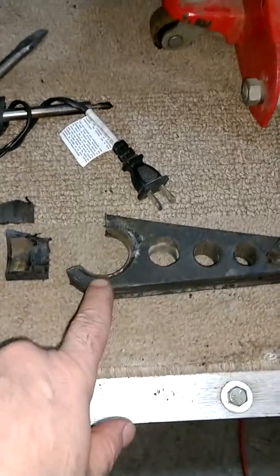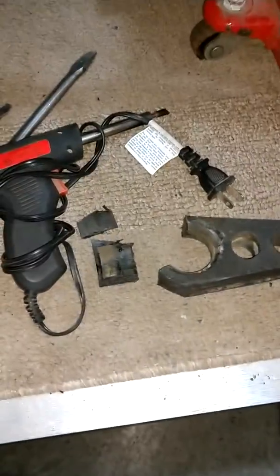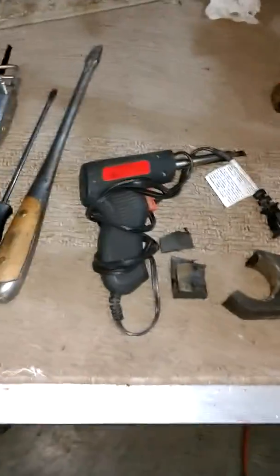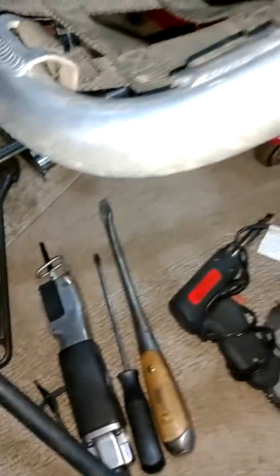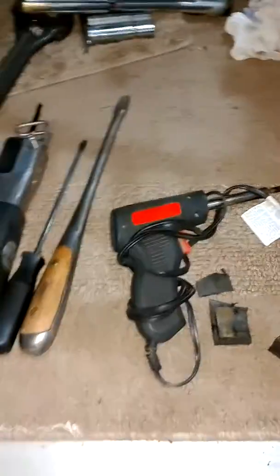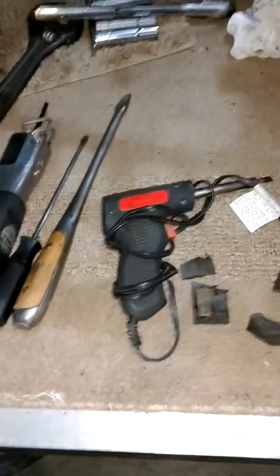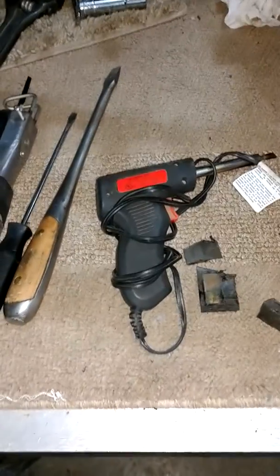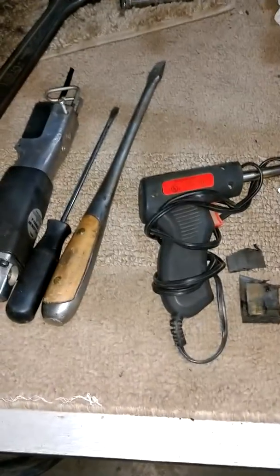That's fine if you've got to rebuild all your bushings and whatnot on your swing arm. If the little needle bearings in there are worn out, or if you've got issues and you want to do a little extra work on there, then that's fine. But in this situation, the Banshee I bought looks like that's been done already, because the back end is tight, and I retorqued the bolt to 61 foot-pounds of torque, so everything's good.